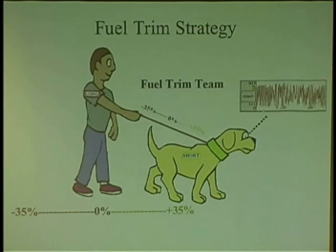Now, fuel trim, understand what fuel trim is. You have fuel trim at different aspects. You have fuel trim at idle. You have fuel trim at part throttle, 3/4 throttle. You need to find out where your problem is going to be. So if your fuel trims are high at idle, power brake the engine. If the trims start to come down, you know it's a vacuum leak. Or it could be maybe a mass airflow that's out of range on a low end. I don't see too much of it. Usually mass airflows fail at a high range.